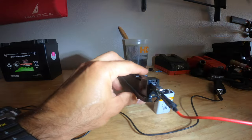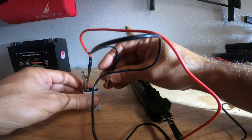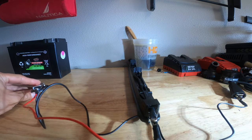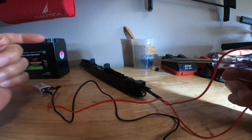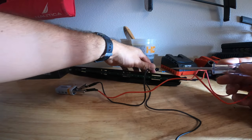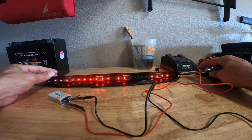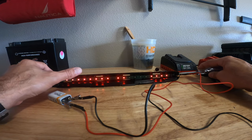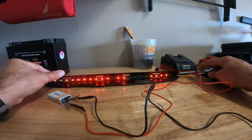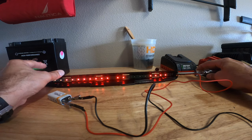I'm going to connect the red wire to the positive terminal on the nine-volt battery, and the negative here to the negative terminal just like that. And since I didn't have a small wire available I'm going to use my test light, which is connected to the negative terminal, to stick it in — and you'll see the brake light illuminating. As you can see my old brake light was really, really bad. You've got some dim LEDs on the left and some dead LEDs on the right. This is just to show you that if you go to the junkyard, just bring a couple of wires and a nine-volt battery and you can test to see if it works.